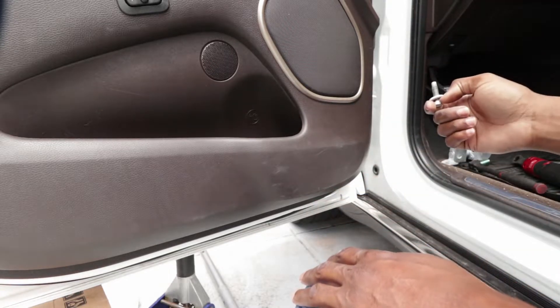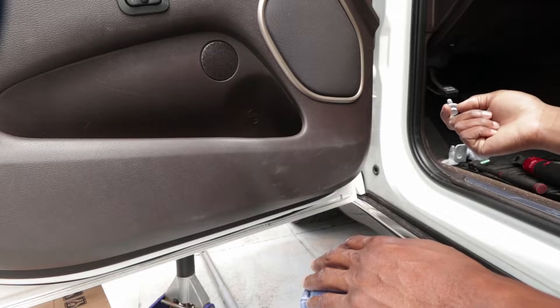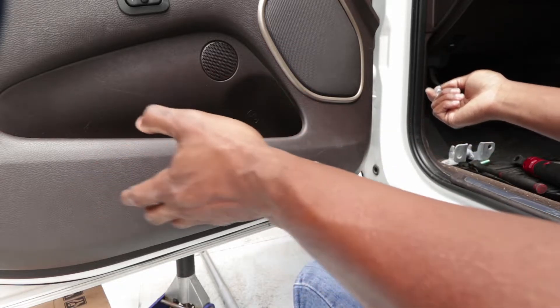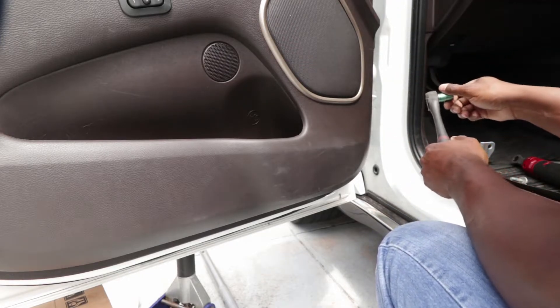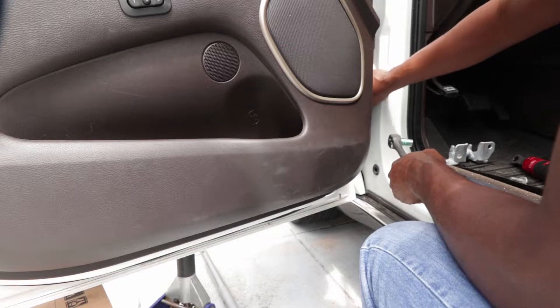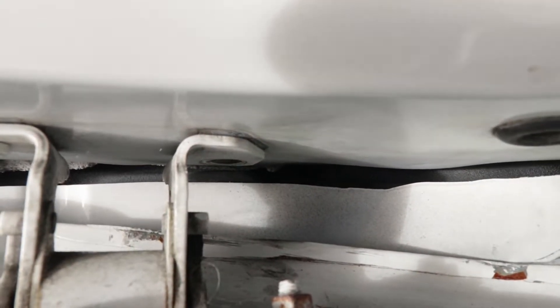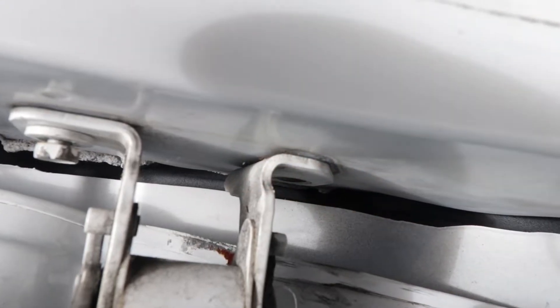As a recommendation, take the bottom bolt on the car side out first, because it requires you to stick your hands in between the door and the chassis. You probably don't want that to be the last one — if the door were to shift or move, you don't want to crush your hands in there. Then you're going to have to readjust to get it back in the right spot, because it is adjustable to align the door. There should be paint marks on the chassis — you can see where there's a little scuff in the paint where the bracket used to live, same on the top. Assuming the brackets are the same dimensions, you should be able to line it back up, and the door should be pretty close to aligned. No promises, though.